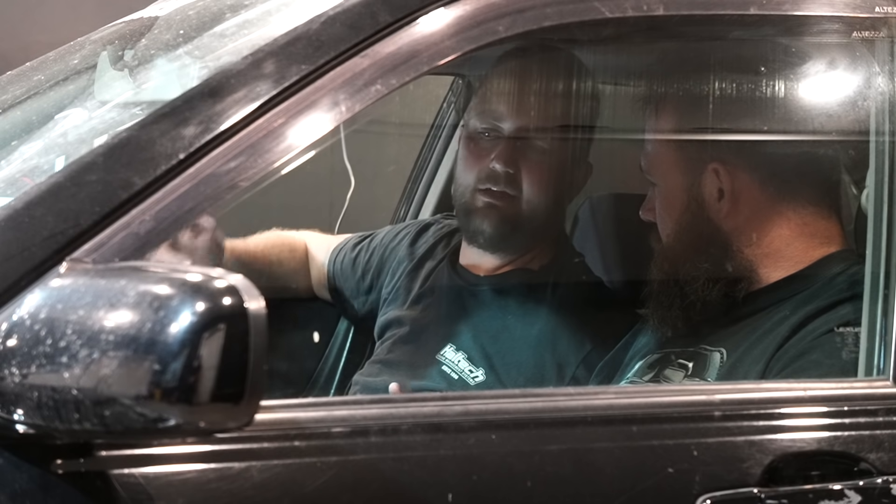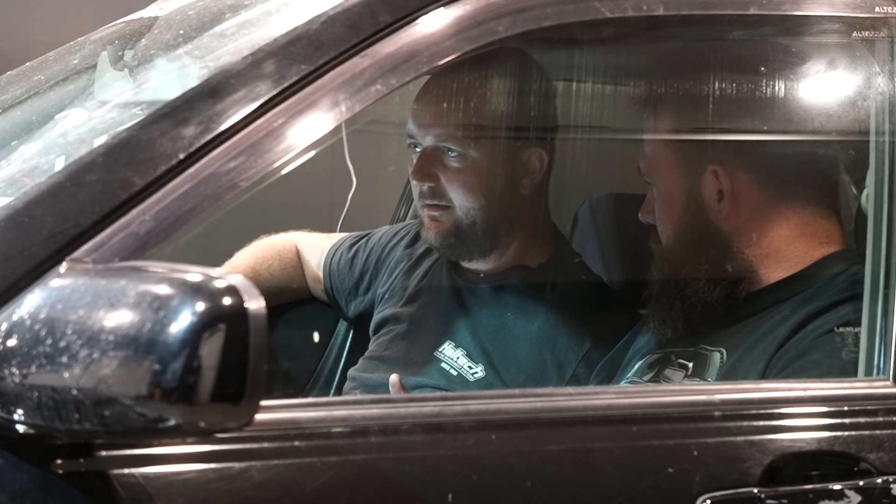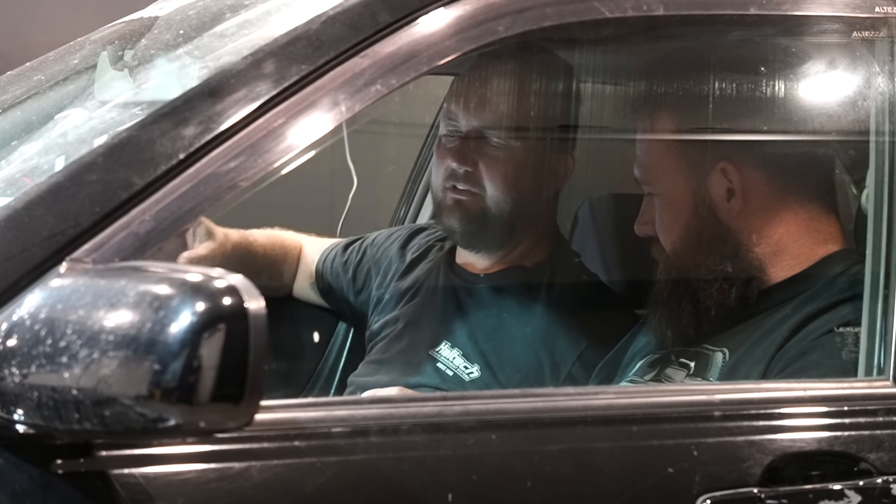Every other person on the internet tells you to smooth out the humps and bumps in the map, but that's the reality — there are humps and bumps where the camshaft comes on song and where the intake manifold has a weird reversion. You have to expect that. All I'm doing here is trying to maximize the number of samples I've got in the long-term learning to apply to the base table, to get it closer to the point. The closer you can get the tune, the better the long-term trimming works — there's less error it's adjusting against.